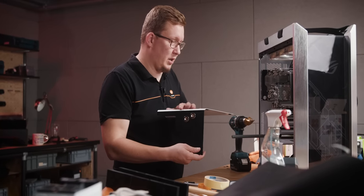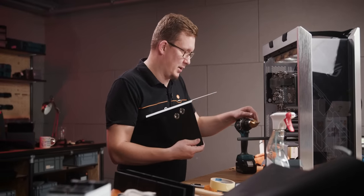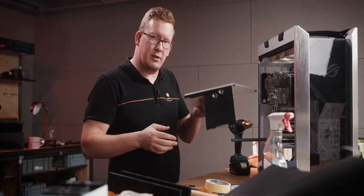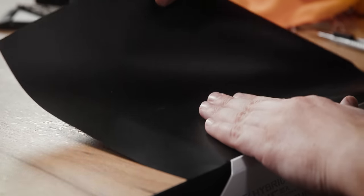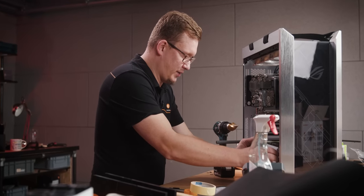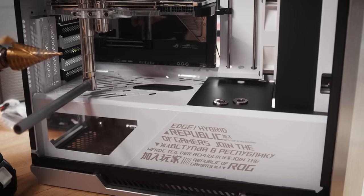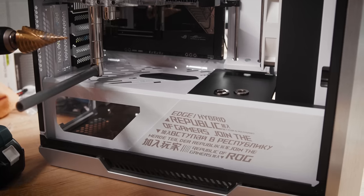Making the holes on the shroud with this tool didn't go as happily as I planned — this tool is more for wood and aluminium, and this turns out to be quite nice steel. I totally didn't scratch the surface. So I applied some matte black vinyl which will actually match the entire build. I'll test fit it. Let's flip the radiator and do the soft tubes at the bottom right now.